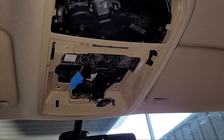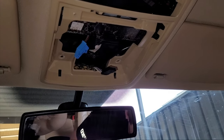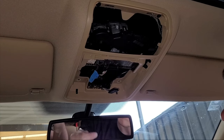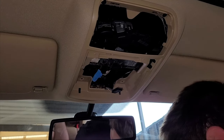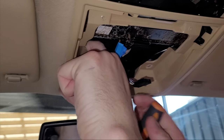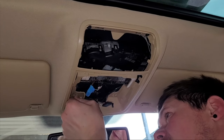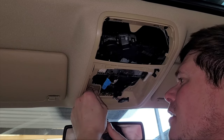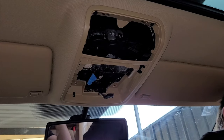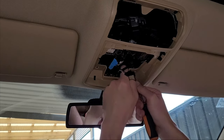The two at the back have a little metal tab bracket behind them, the same as on the sun visors and grab handles. Make sure that little metal tab doesn't fall out of place, because if it does you'd have to get in there and line it back up, possibly even removing the plastic unit again. That would also be a T20 Torx head screw. Get in there with a flathead and push the bracket over a bit to align where the screw's going in if it's shifted during the removal stage. Once those two screws are in, proceed to putting all the units back onto the sunglasses console.